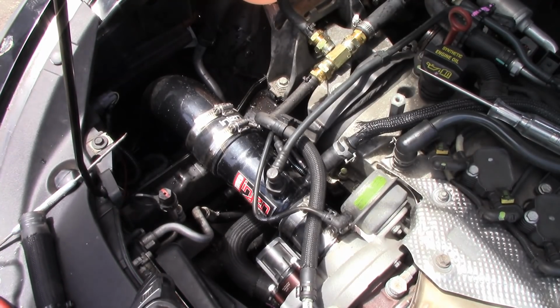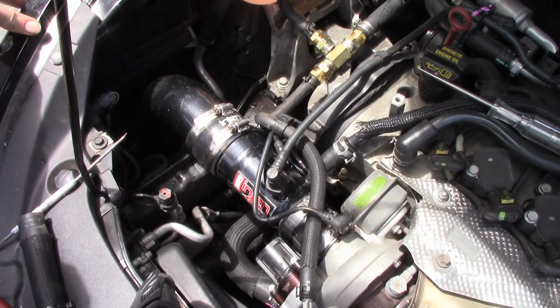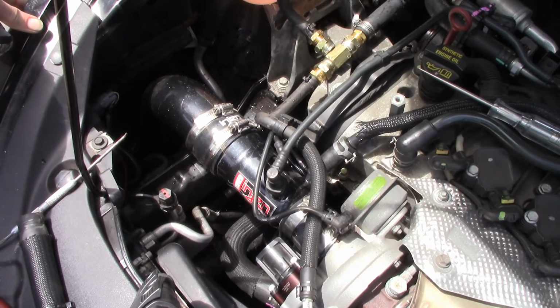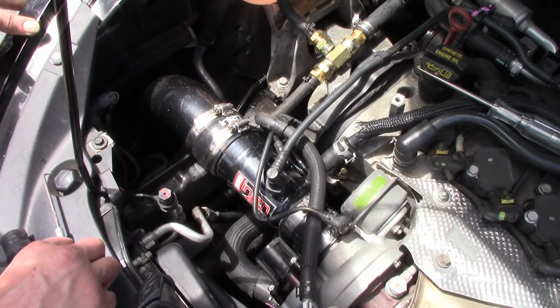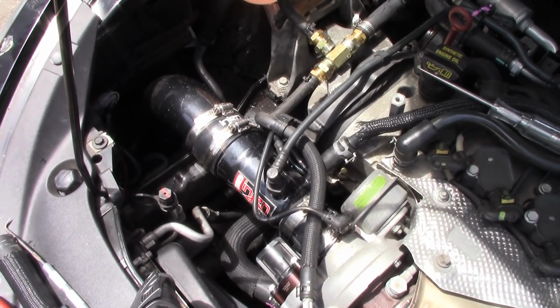When we left off, we had a fuse blown, right? 10 amp, which controls, or powers, I should say, a bunch of things, including the O2s, the wastegate solenoid, vent solenoid, I believe, some other miscellaneous equipment on the car. So where I'm at now is we need to figure out if the fuse is going to continue to blow or not. I don't know if this is an intermittent issue. This was never even diagnosed as a blown fuse from the other places that it was at. So we're going to see where we're at. I'm going to get myself in position here, start the car, and we'll go from there.